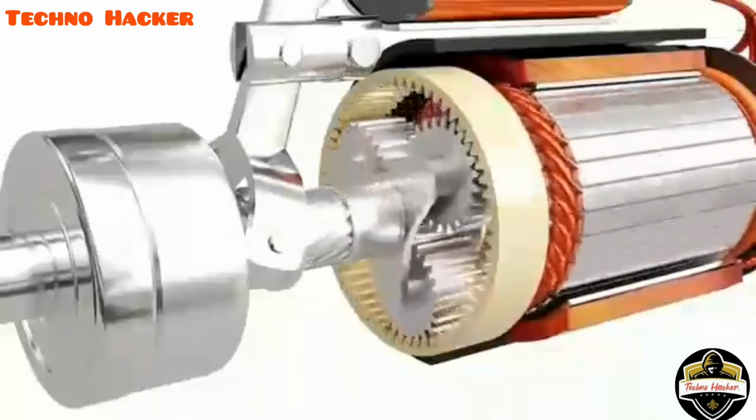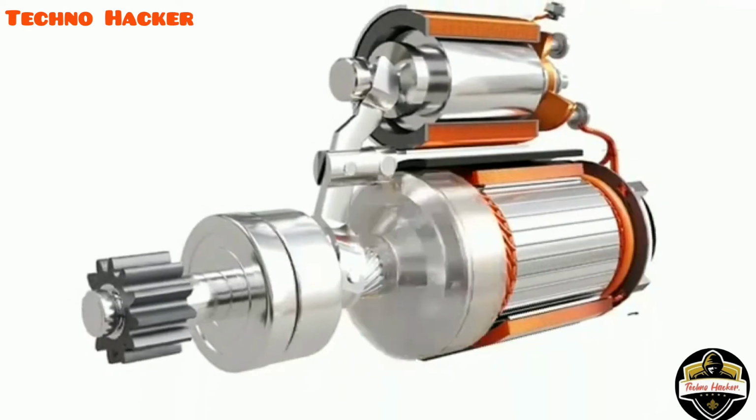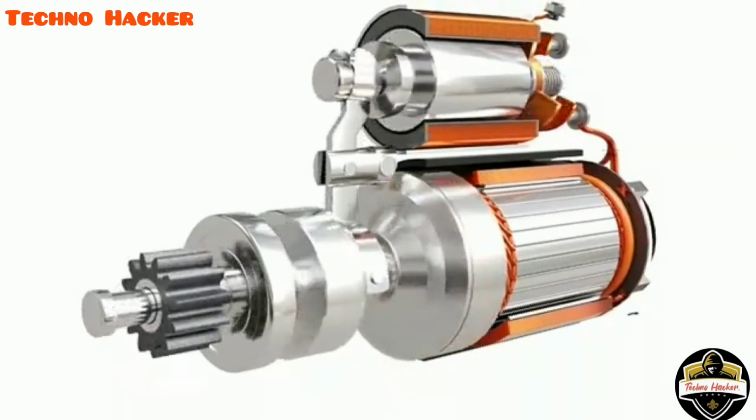As the engine is started, the pinion needs to be disengaged from the flywheel to prevent backdrive of the motor, which might damage it due to the excessive speed. This is done by releasing the ignition switch, which de-energizes the solenoid, and the pinion returns back.